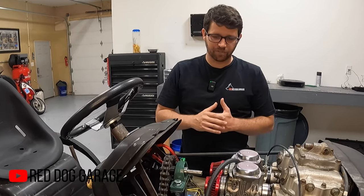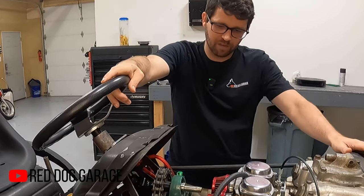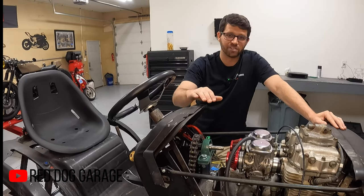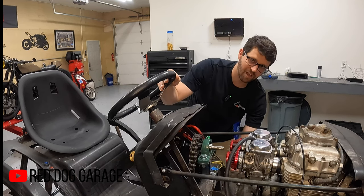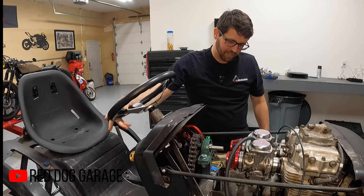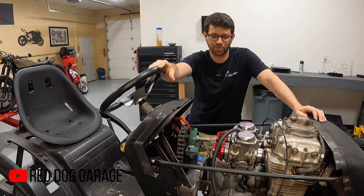After thinking about this for quite a while, I decided that I needed to just drop the steering straight down. I found that using a sprocket supported by a top pillow block coming off of the steering wheel, and then dropping it straight down to another chain and pillow block, was the best way to get around the engine. This allowed me to stop right here with the steering and drop it all the way down to underneath the engine where it was no longer in the way — and I wasn't going to be interfering with the drive sprocket or the shifter. It's a complicated-looking solution but it works really well and is actually very simple in practice.